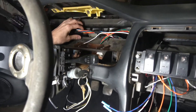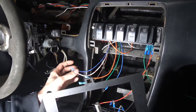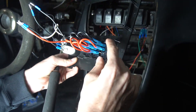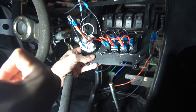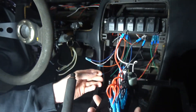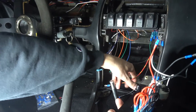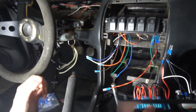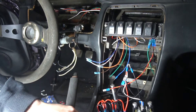Here again are the 14 wires — the whole wiring harness I made — coming up and running under here. Majority of the switches are going to go into each side of the switch. This one's a double rocker because it's our turn signals, so we'll have a relay for each side. The remaining wires run to each of these switches. To explain the rest — all our positives, all our negatives — and I have this running up to these switches, giving 12-volt ignition on the first click, which sends power to turn on the relays.